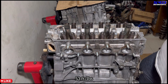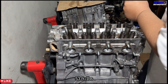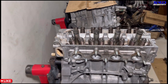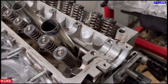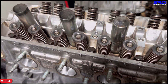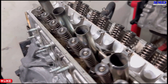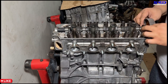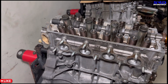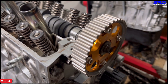I'm going to time-lapse this so it'll go quicker. Now it's all torqued up — power valve springs and retainers looking really good for the Crower Stage 3 cam. The head is all torqued up. Let's slap on the cam just for fun — brand new Crower Stage 3 cam. This is gonna be a fun motor!